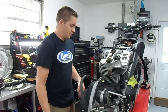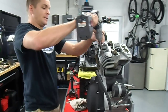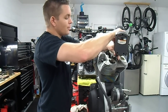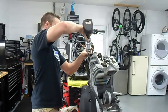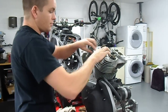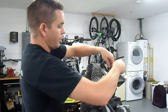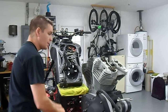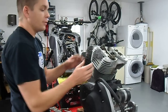So now I'm pulling the motor apart to see what kind of damage I've got. I've got most everything off of here. I'm going to pull the cylinder box and see what kind of mess we have in here. I've already looked — it looks like I might have a bent exhaust valve in the rear. I think it's the rear rod that broke. I can see through the big hole in the front of the case.